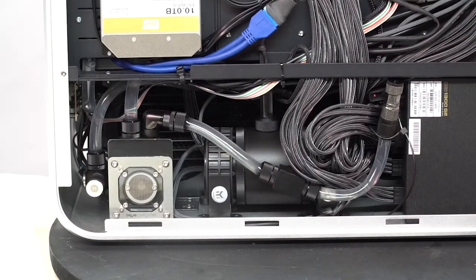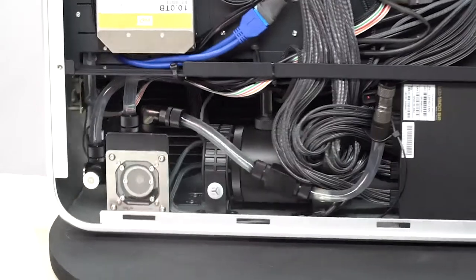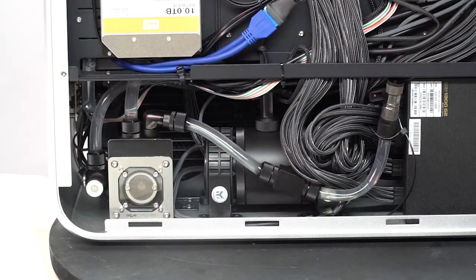This is your power supply back here. The power supply has a very large fan on the other side that is also drafting air from your radiator, and it's spitting it out here. So you've got air coming in and going out that way. Although the power supply itself is blocking the radiator, it is not blocking the airflow from the radiator because of this configuration.